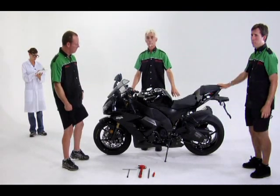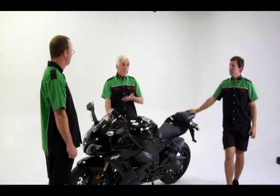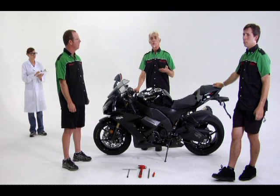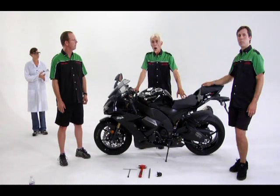the preload. We got the sag measurement by subtracting the rider on number from the fully extended number. In this case, it's 137 millimeters less 104 millimeters, and that equals 33 millimeters on the forks. We'll need to go 3 millimeters to get his preferred sag. Okay? We aren't too far off on either end, so let's adjust the forks and add preload.